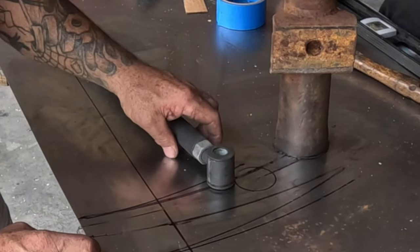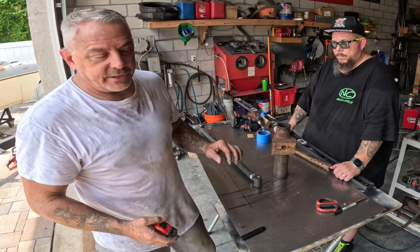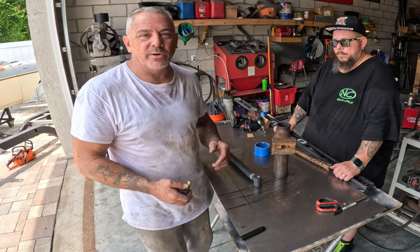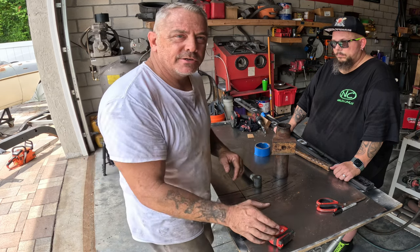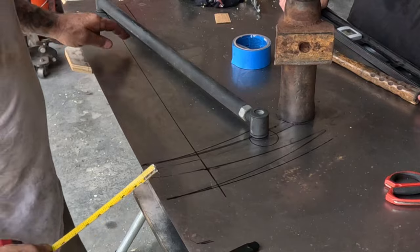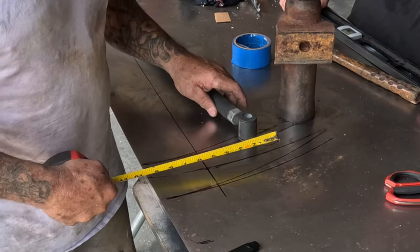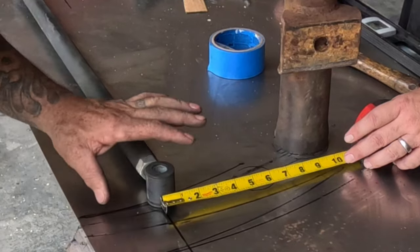If we move the mount down lower, you can see you're almost pretty much vertical. In theory, when we cantilever this setup, the bag is going to get mounted right about here. The car is going to have probably a good 10 to 12 inches of lift easily, because a 2,600 pound bag is somewhere around 9 to 10 inches, depending on how much pressure you put into the bag. This right here represents parallel to the ground. So when she raises her car up five inches cruising, the two-link will be parallel to the ground.